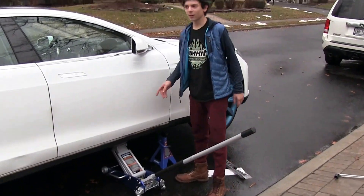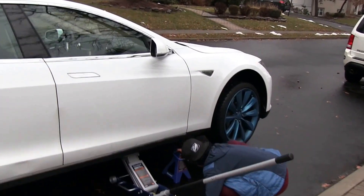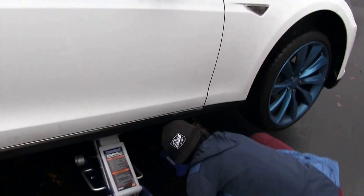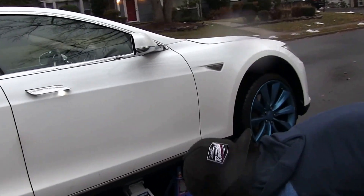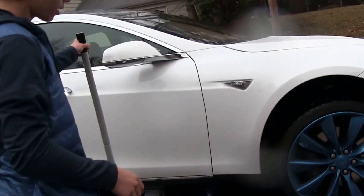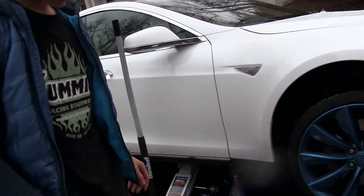Being an electric car, there's some pretty bad acids in that battery. Tesla has a mounting spot — they don't just recommend, they demand you only mount on the frame rails, which are these steel parts right here. So you place the jack right there, lower the car to that point, and jack it up so the jack is just touching the car as an extra means of safety.